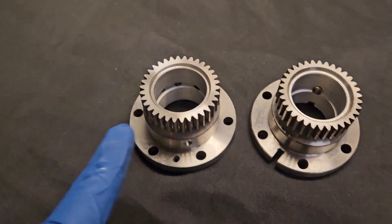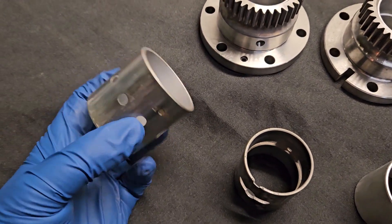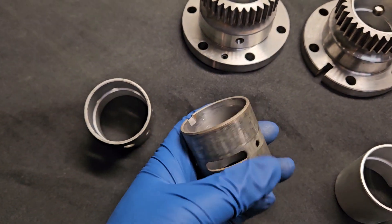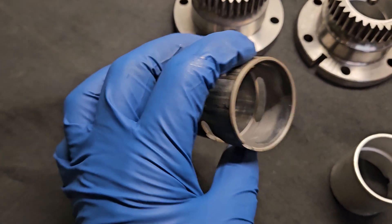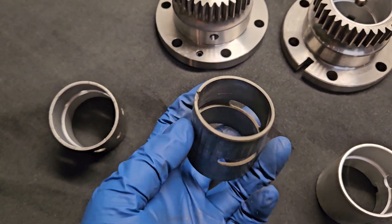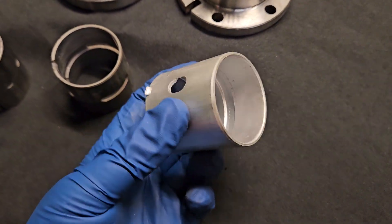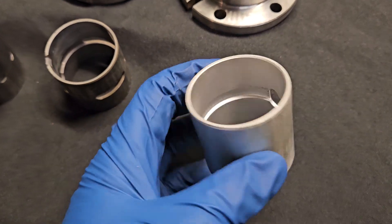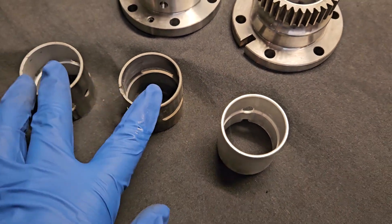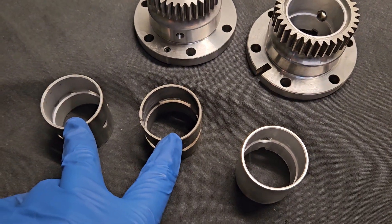So there you go — that's kind of cool stuff. Your OEM multi-window bearings have little holes like this, so it's able to spill out around the shaft. Your aftermarket three-window from RacingBeat looked like this — these were very, very good. I used them in a lot of my race motors and saw them used in tons of race motors. Also fantastic. And then here you have just your base bearing. It is notable that these dimensions are very similar to your race dimensions.